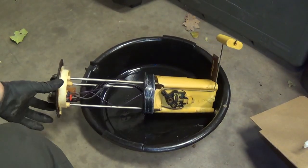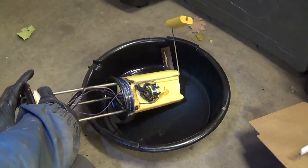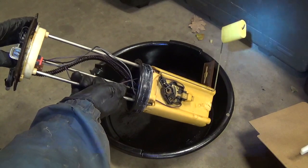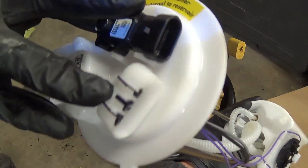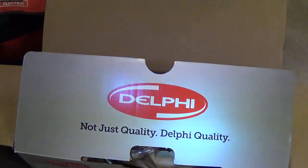Comparing the old sending unit with our fuel pump assembly and the new one — you can see that the plugs are actually different. This black one is the fuel tank pressure sensor, the white one is the sending unit, level gauge, and power and ground to the actual pump. Looking at the new one, it's not the same — it's a four-pin flat connector. In the kit they actually give you a harness and wires and butt connectors. It's supposed to be a Delphi genuine part — why do they have to change connectors on you?